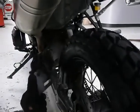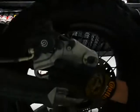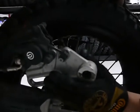Okay, now it's really important. This has to be attached to the swing arm. If you don't have this sitting there, the moment you apply the brake, the caliper's going to roll around, it's going to jam the wheel up, rip the brake cable out, and consequently you're going to have a whole lot of hardship. This is the lug we're talking about. Yeah, it's this lug down here. Yeah. Okay. So, the mount on your bracket is this slide here. Yep. So when this goes in, it's important that you get that to sit down in there.